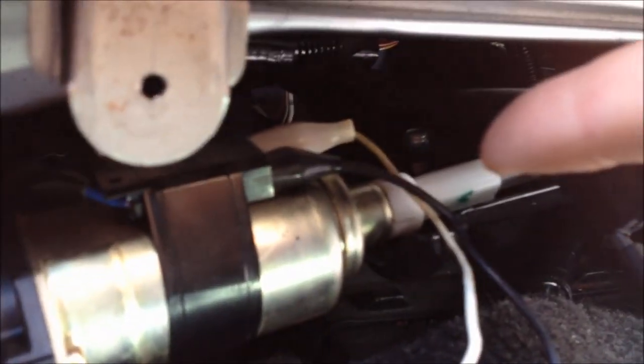Next, we're going to take and reverse the wires to the motor that drives the front seat forward. I unplugged this plug from that connector, which was taped to the motor — that might have been part of a recall — and I used alligator clips. I poked them into the connector and into the other side, the female side, and reversed the polarity. I'm going to take advantage of the one side of the switch that still works to move the seat forward so I can get to the rear bolts.